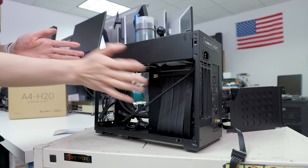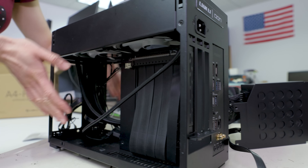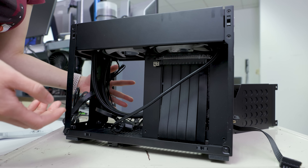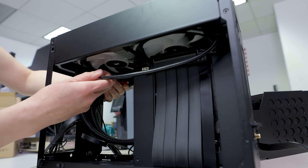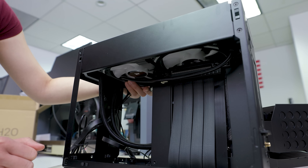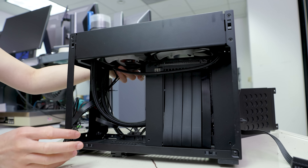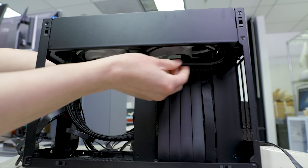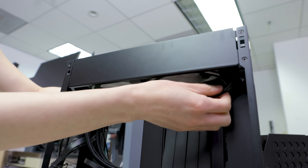Starting with the GPU side: this is a sandwich layout with two chambers — one for the GPU and one for the motherboard and power supply. When this chamber is empty, you've got plenty of space for a graphics card. However, once you build out, you'll have a power extension cable routing from the back to the power supply, and you'll need to maneuver the graphics card into the riser cable's PCIe slot. The riser cable mounts up top, goes down underneath, and connects to the PCIe slot on your ITX motherboard.